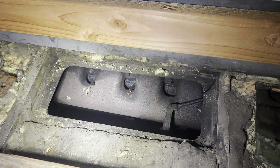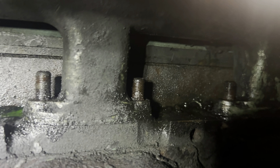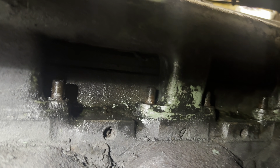I made my rear engine access accessible — pulled out the insulation and stuff that seals it up. We need to get to that manifold right there. We got all the nuts off. We just got to get it separated, so I should hopefully be able to get a little chisel in there and start getting it to free up. When it's aluminum and those studs are steel — I see there's two washers still on that one, let me get those washers off, that'll help free it up a little too. One of the studs came out on that last one on the end.